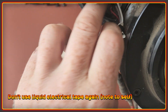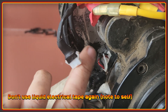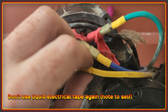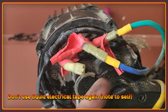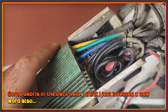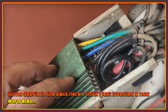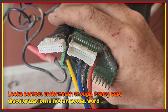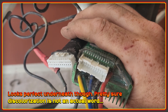I'm having real trouble getting this Halls plug out because the dried electrical tape bakes hard, and I don't want to damage the JST underneath. I'm going to take the motor off with that still on and figure it out elsewhere with more light. These plugs show no discoloration — you can still see the dielectric grease I put on originally. There's some dirt and debris in the back, but no discoloration. On the inside it's absolutely perfect, which means the dielectric grease and all the extra wrapping did its job.